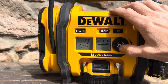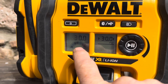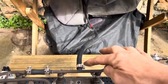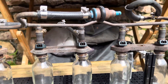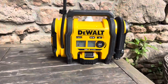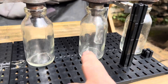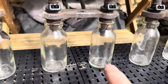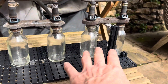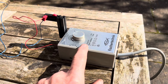This is now pressurized to 30 PSI. You can see that pressure is very slowly ticking down, which means that there's a leak in the system - this could be coming from one of our fittings or it could be a drip from one of the fuel injectors. About half an hour later, you can see whilst the pressure has bled off a little bit down to about 29 PSI, there are no drips in any of these bottles, and therefore the fuel injectors themselves are not dripping. There might be leaks from some of these connections, but the injectors themselves seem not to be leaking, which is good news.